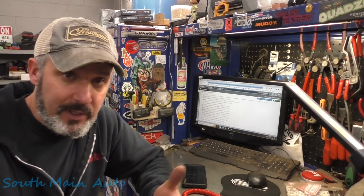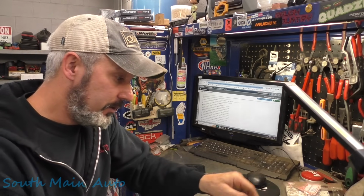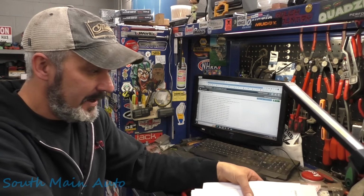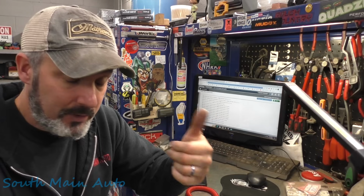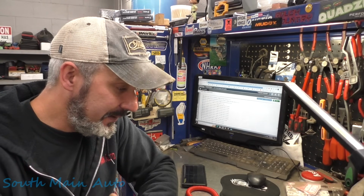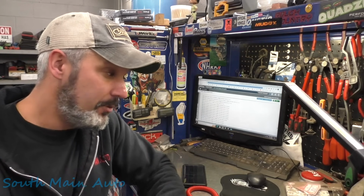So I hope you guys are kind of following along at this point. I think we've narrowed it down pretty quick in the sense that it appears the body control module functions, or it's working. But it clearly isn't making the signal all the way to the relay, and that's essentially exactly what the code criteria was, where we left that, basically stating it was either shorted or open circuited in that control side. We were able to narrow it down to see that it's not shorted, because when we plug it in, it's not kicking that on at least on this side. And then we also found quickly that it was open circuited, because we've seen that the body control module has the ability to control it. We could turn our test light on and off when we applied power. However, when we grounded it, it didn't turn on that relay because there's no connection from the body control module out to the fuse box.